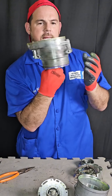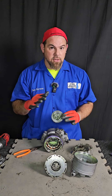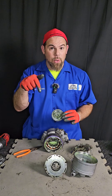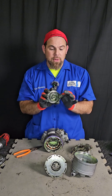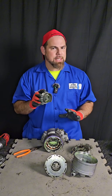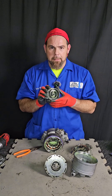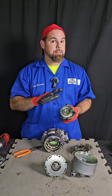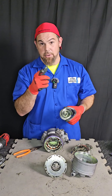This bearing is not so bad but it has a little noise as well. Unfortunately, mechanical failure in the AC compressor of the European Volvo is also a very common issue in their hybrid electric vehicle version. My strongest recommendation for the air conditioning system in hybrid electric cars: do not use it at the lowest temperature setting. Remember, this is a variable speed electric motor, so if you set it to the lowest to cool down to the maximum, the compressor will spin at its maximum RPM, which is really not necessary. My recommendation: 23 to 24 degrees — you will still cool pretty well at a low RPM. This has been working well with my customers with absolutely no problem with the AC electric motor. Mechanical failure in the AC compressor in Volvo — if you want to learn more, stick around for more tips. See you then, bye-bye.